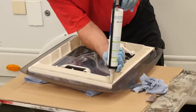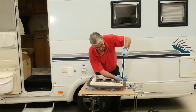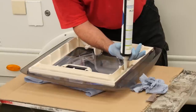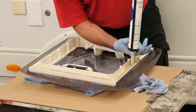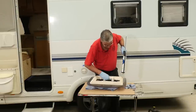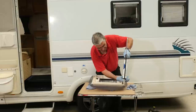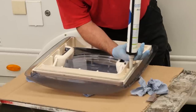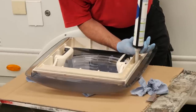It's always the tricky bit turning the corner with this. Take your time over this because it's probably the most important part of the job — making sure that you get a good sound bead of sealant onto the job. Always make sure that you've got something soft under the roof light so you don't scratch it. Wear some gloves because this stuff won't hurt you if you get it on your skin, but it takes a lot of getting off. It sticks.